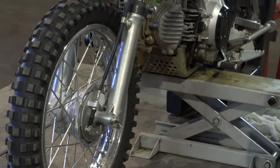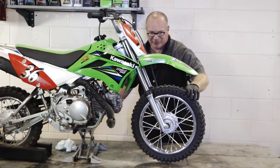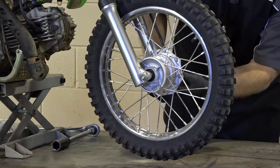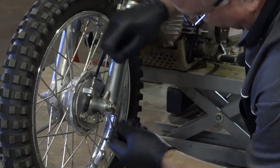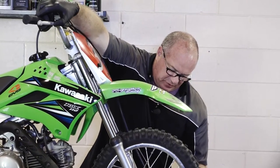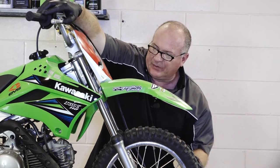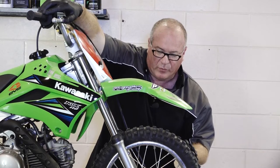What we're going to do is go ahead and lift up the front of the motorcycle just using a little scissor lift. If you don't own one of these, you need to buy one — you'll find reasons to use it. Before I do this, I want to tell you what you're looking for: if you've already gone through your full range of adjustment here and up here, that typically means the brake shoes need to be replaced. On this particular machine, are they worn out? No, they're in fantastic shape, but I still want to go through the process to show you how to replace them if yours are worn out.